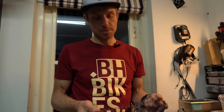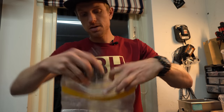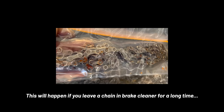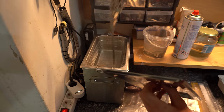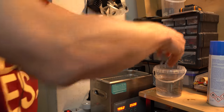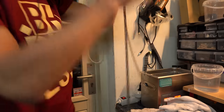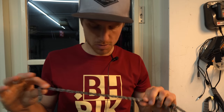This is the most important step. I'm going to use brake cleaner, which is also a very strong degreaser. I'll use the bag again, put the chain in, spray it with brake cleaner, but not leave it in all day — just a little bit. Then I'll clean out the ultrasonic bath and do the whole process again to make it super clean. After rinsing in clean water, you can already hear the difference because it makes a rattling sound. Now it finally feels dry. A new chain is always a bit of extra work to degrease.